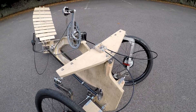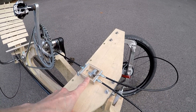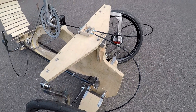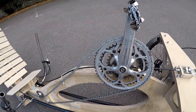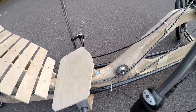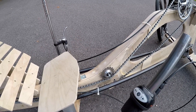A quick canter through from front to back. Here I've got the brake splitter for the single brake lever, which is on the left hand handlebar. I've got the brake cables going down to the front drum brakes — one on the right, one on the left. Moving further down, I've got the crank here and the chain rings. Chains are all fitted. Those are the idlers that take the chain around the various directions it has to go in.